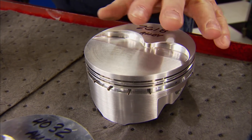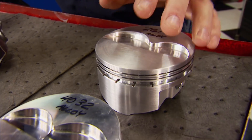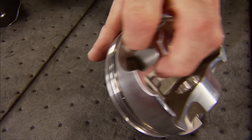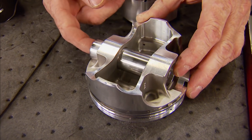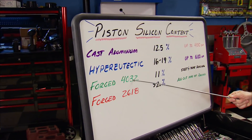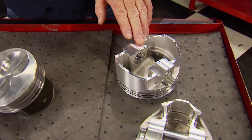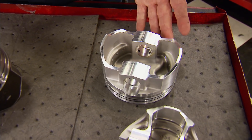The strongest and most durable piston is a forged one. It's made by taking a semi-solid casting of high-strength aluminum alloy and forcing it over a die at extreme pressures to its rough shape. This process removes any porosity and tightens the grain structure to withstand the rigors of higher temperatures and pressures associated with all forms of racing. It's finish-machined to ultra-high tolerances because of its molecular stability, and the wrist pins are retained in the piston with spiral locks, clips, or wire locks, with the connecting rod floating on the wrist pin. The two common alloys used in forged pistons are 4032 and 2618. While both are superior to cast aluminum, they differ in their capabilities. 4032 has 11% silicon content and expands less than 2618. There aren't any steel inserts in a forged piston because the thermal expansion is more predictable and controlled by the material itself and the piston's design.